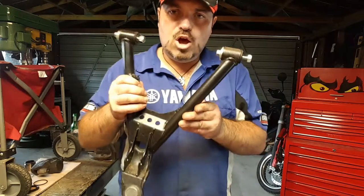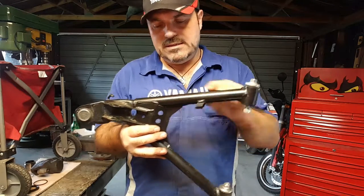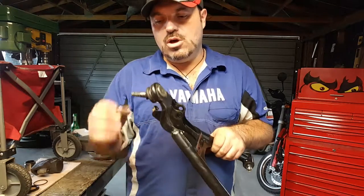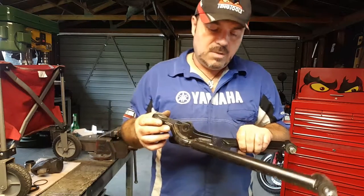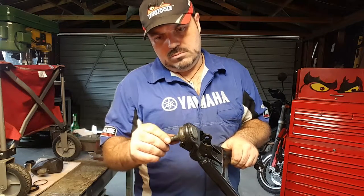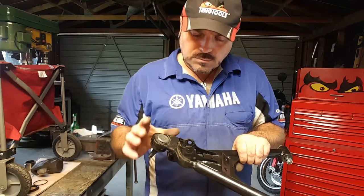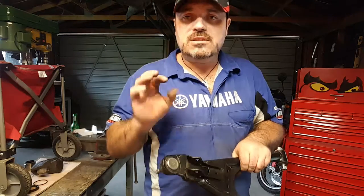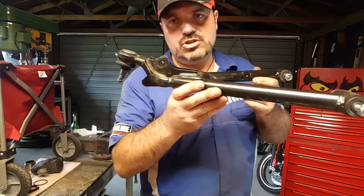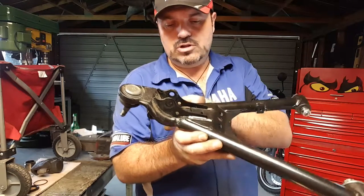As regards the upper wishbone, this is a little bit shorter and a little bit stronger. The tube is a thicker design, but the upper wishbone we know took a pretty big amount of the force when the vehicle was pushed across, because we know that the point, wow, I think that's bent. We'll be taking that in a minute. It was subject to the majority of the force by the four-wheel drive pushing it. And the weak point, because it's not straight, has this swan neck at the end for the ball joint. Okay, it's cast, but cast can bend. We know that because the knuckle joint's bent.